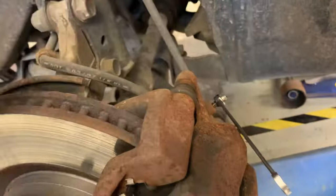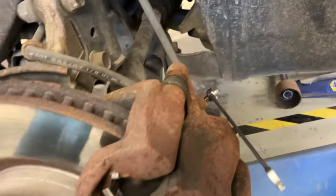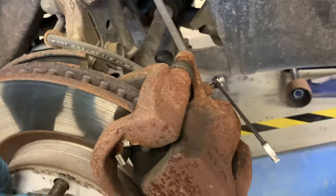If you do this test with the rotor stuck, you open that bleeder valve, and a bunch of fluid comes squirting out and all of a sudden you can rotate the rotor, you need hoses and you don't even need to replace your calipers — which can be a relief because sometimes these calipers are expensive.